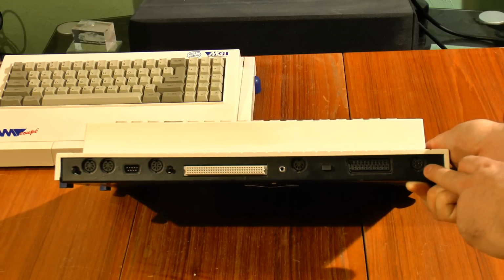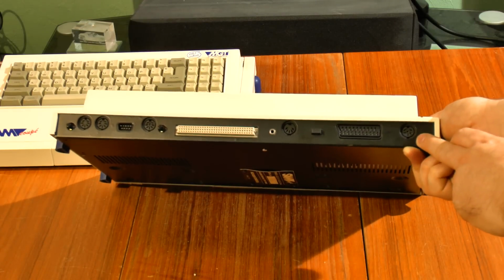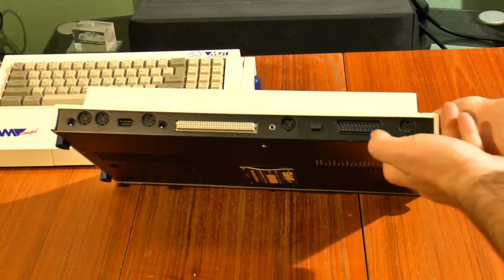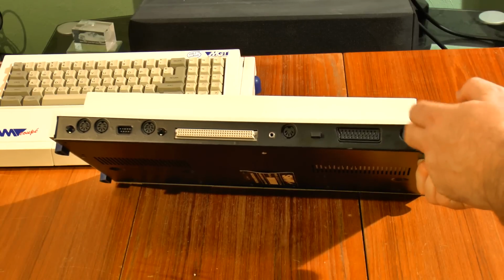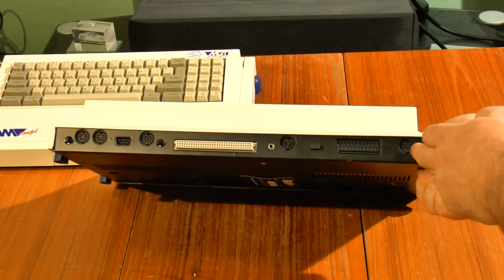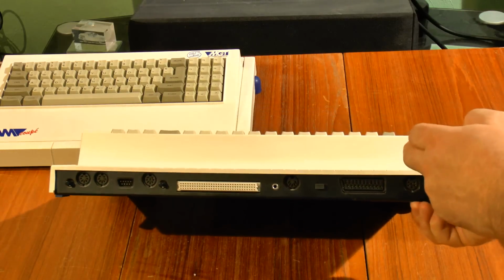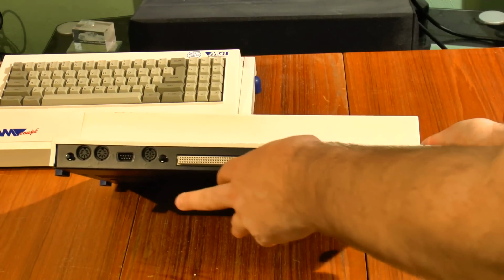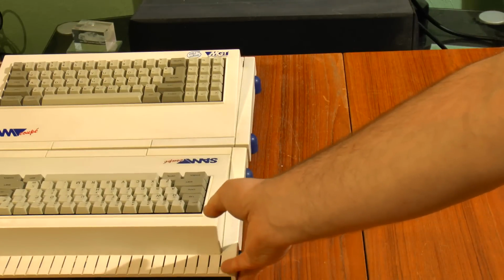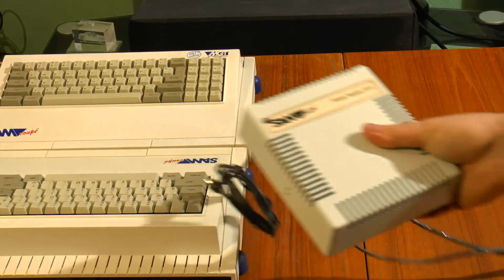Then we have the power connector, which is a 6-pin DIN, and again, it's non-standard. It's got 12 volts, it's got 5 volts, and it also carries the left audio channel and video channel out because, as you can see, there's no RF modulator on the back of this. To connect to the TV, if you're not going through SCART, you have to use the power supply,